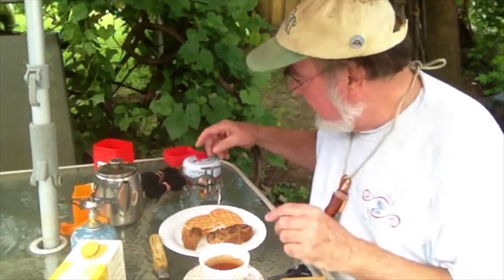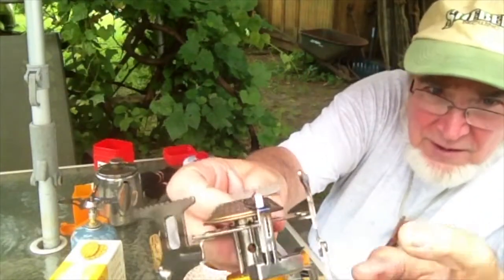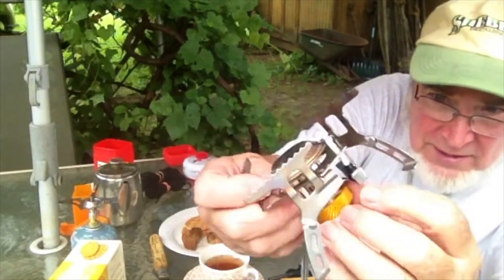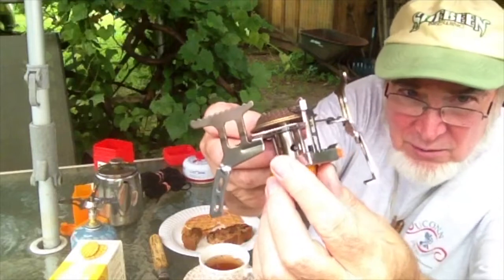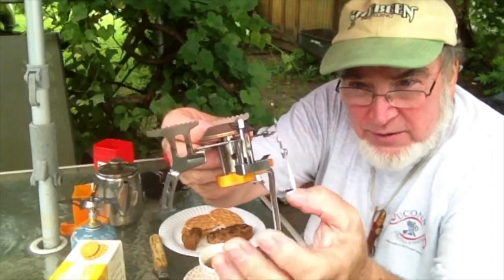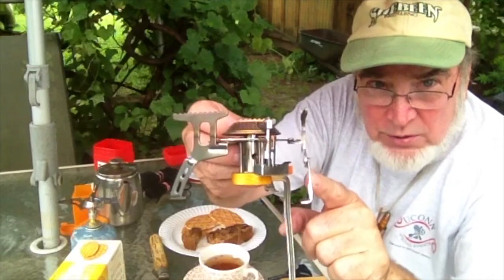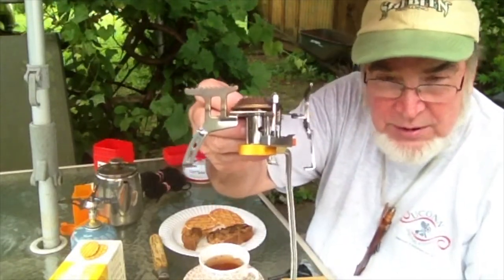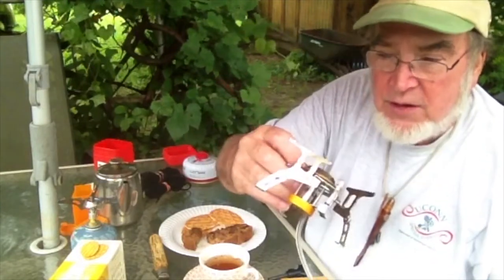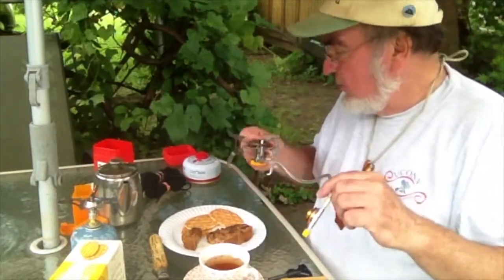What happened on that Piezo is — let me show you here. Not this one, but the filament. That white filament in there was cracked. And there's like a silicone sleeve on there keeping it together. So it would get the charge, but not the spark. So when I took it apart, it would spark. But this filament was broke. That's why I wasn't getting a spark. But I took the whole thing off. Not a problem.